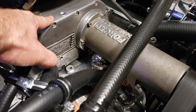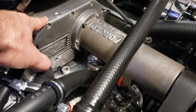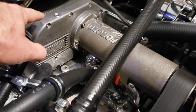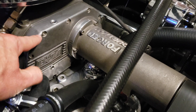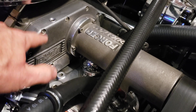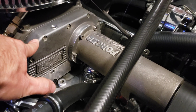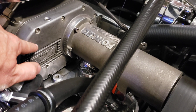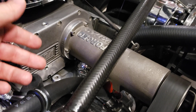Behind this front cover is a bath of gear oil. You don't necessarily have to change it because as it operates there is some intentional seepage — very little — as it heats and cools into the blower housing and kind of goes down to the engine. So it does lose a little bit of oil over time, pretty slowly. That will depend on use, how much power you're producing, how many miles you're putting on it, and so on.